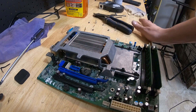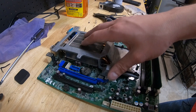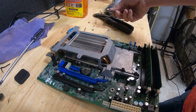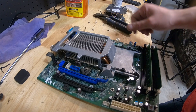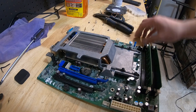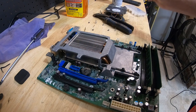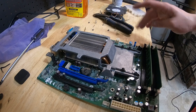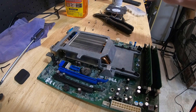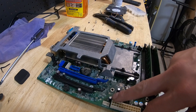Just wanted to record this as a quick tip for anybody trying to use this motherboard and running into the CPU cooler issue. If the cooler goes bad, you can buy another one for ten dollars on eBay, or get the adapter — pop that in there and you won't get that fan error anymore. I'll post links to my other Dell videos including the front button pin-out. There are better videos than mine out there, so I recommend searching for them, but mine gives you a general idea.